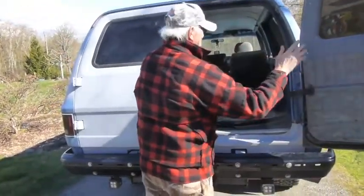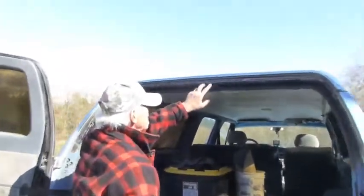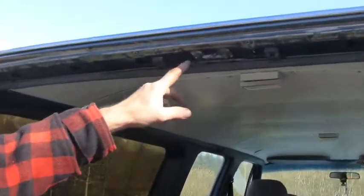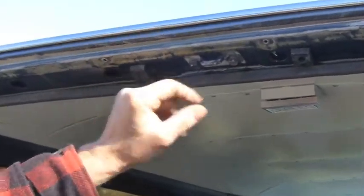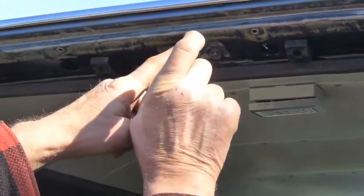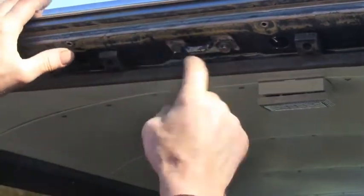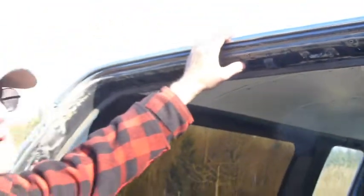The other part I didn't have from my donor vehicle was the nut plate that goes underneath here. What I did — I put nut inserts in these two rub blocks, and then I actually had a wire on a piece of flat bar with a nut on it that I fished through here and started these two on. That worked great.